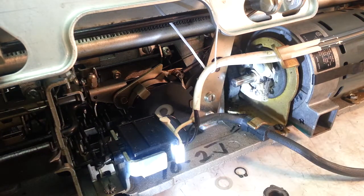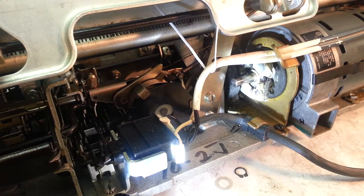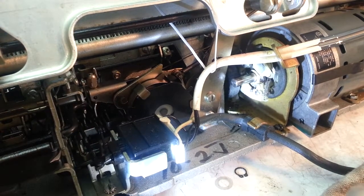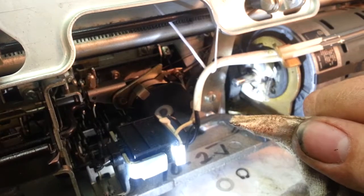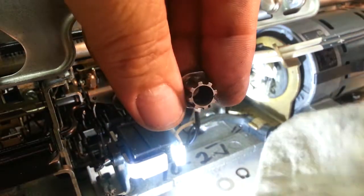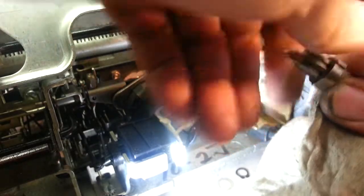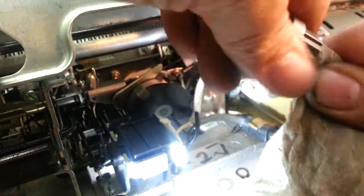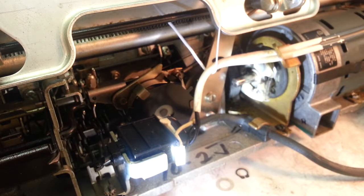We're going to clean this up — put some cleaning agent right down in here. Clean this part, clean down the shaft here, get this all cleaned out and all the old oil out of here. Make sure this is cleaned out — sometimes it actually gets rusty inside here too, so you might put a piece of sandpaper in there and sand it slightly. But usually just cleaning it like this will get it clean enough. Make sure these grooves are all clean.